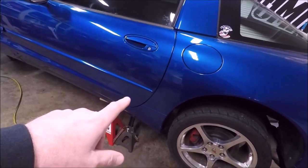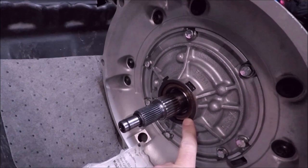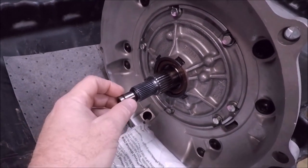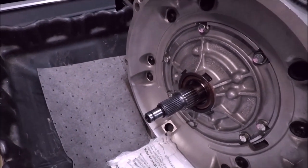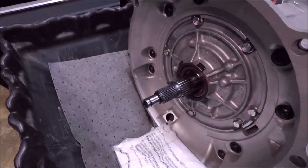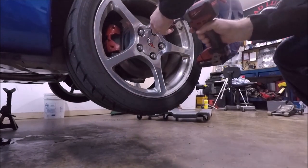After crawling under the car I can see the fluid is coming from inside the bell housing area. I think we're looking at one of two things: most likely the front seal has probably pushed out, maybe the clip has popped off. I'm not sure what causes that — excess line pressure, maybe something that also caused our second gear failure. On the more extreme side it could be a cracked torque converter. We won't know until we get the transmission out.